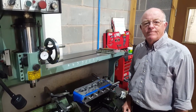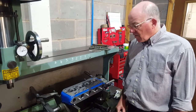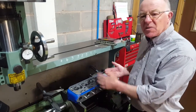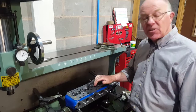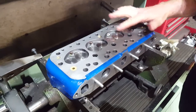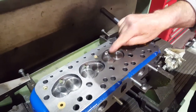Welcome back to MED. Today we're going to look at cylinder heads. We've got a finished Mini 7 S-Class head here, but it isn't quite finished because it needs skimming. What we're going to do now is check the combustion chamber volume — the actual volume that's in this combustion chamber. You'll see we've got the valves in and we've actually put a spark plug in there.